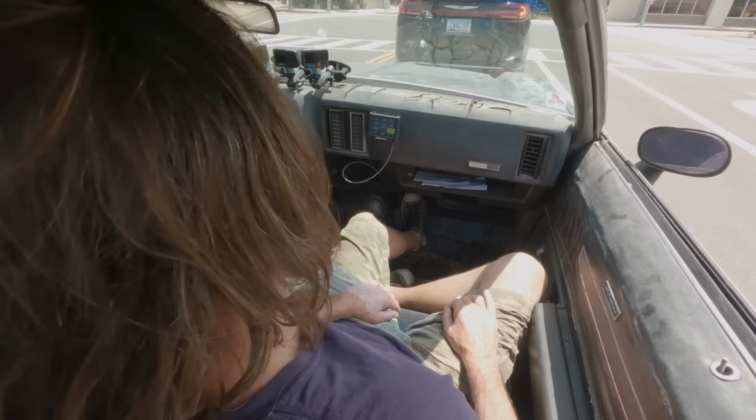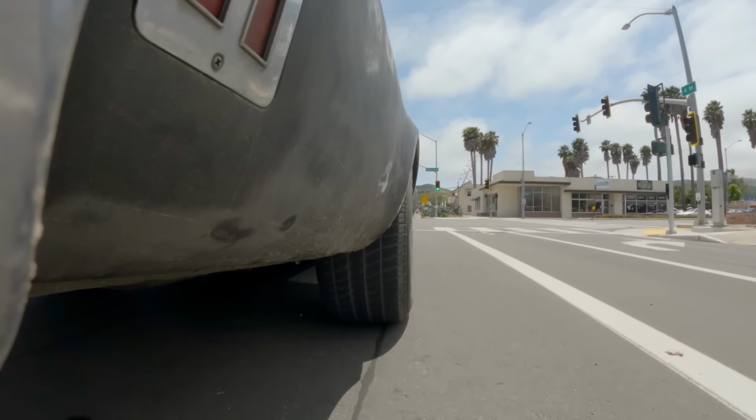What we're looking at now is our little handheld controller, and it will read out for us the air-fuel ratio that it's targeting and the actual air-fuel ratio. And you can see the percentage of learning on the panel. That does not mean, oh, it's 90% learned, it's about to be 100% learned. No, the percentage on there is how much fuel is being added or taken away in order to match the estimated baseline table. And then it also knows what it wants the air-fuel ratio to be. So once it learns for a while, you can transfer the learning table to the base table, and then the amount of correction won't be as much. Right. That's how much offset there is to the base tune. That was the easier way to say it.